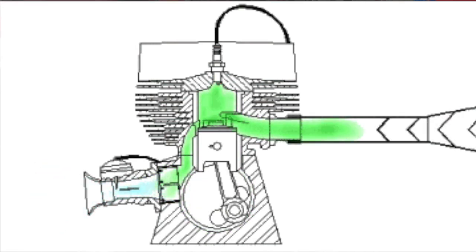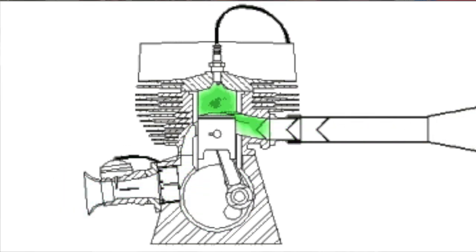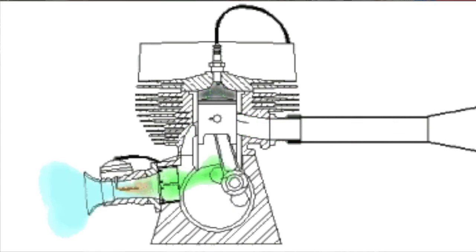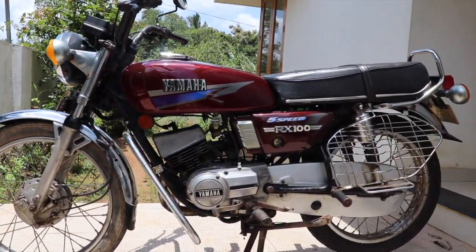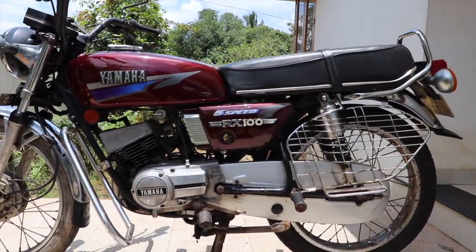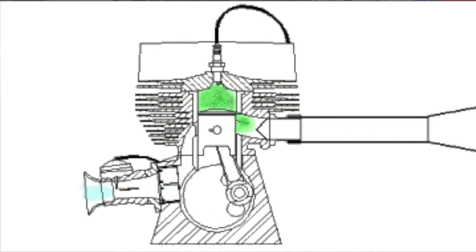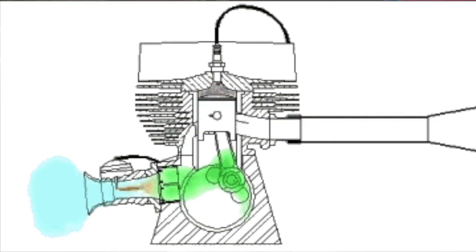The process of injecting fresh air to assist the displacement of exhaust gases out of the combustion chamber is known as scavenging. Technically, at the top dead center, charge ignition happens — it's usually a few degrees before top dead center. In Yamaha RX bikes, it is 17 degrees before top dead center. When the compressed air-fuel mixture is ignited, it leads to an explosion which puts a lot of force on the piston, moving it down with great force.